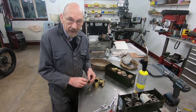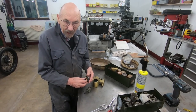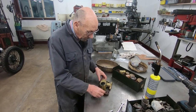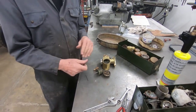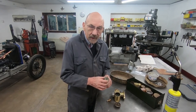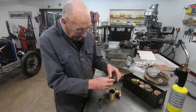And it was exactly the same on a Bugatti, because they've got a Zenith carburettor, and those Zenith carburettors had a very similar mechanism to that. And again, they were always flooding. So I altered the Bugatti carburettor when we went to methanol, because you have to get a lot of fuel through for methanol. What I did was I more or less copied the Amal carburettor, which is on a motorbike, subject to a lot of vibration, and their method has no mechanism. The float goes up and shuts the fuel off. So you're not relying on all this lot, which gets worn very quickly, because as the car's going along, this is going up and down continuously.